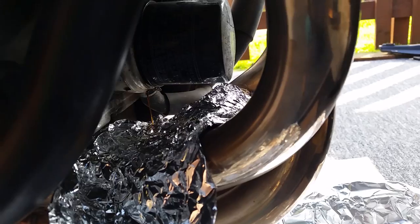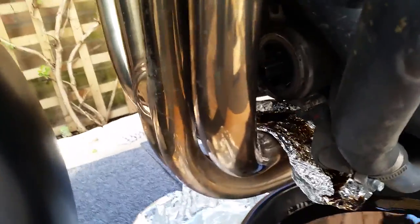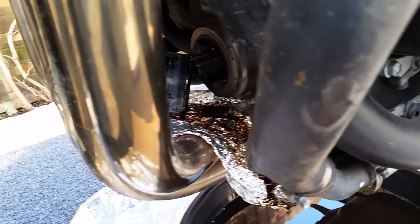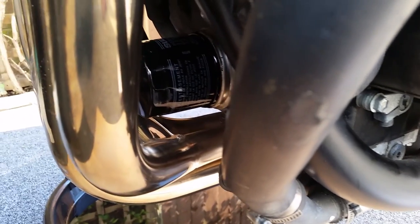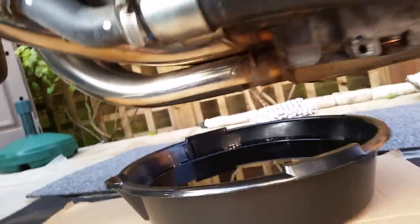Clean up all the mess around, take the foil out and clean up any mess around there and then install the new one. Just taken the oil filter off and laid it on top of the foil there, just letting it drain out a little bit more before I wiggle it through this small opening between the exhausts and the radiator hose. Just have to pull the radiator hose back slightly to pull it out. There's the new oil filter installed — cleaned up the exhaust a little bit while I was in there. Naturally you want to clean all the surfaces before you put the filter on and just smear a little bit of new engine oil on the O-ring seal before tightening.